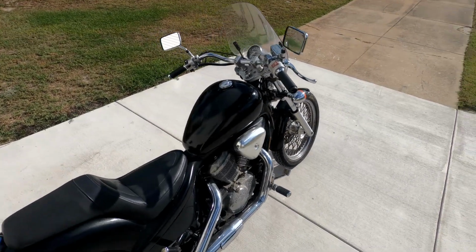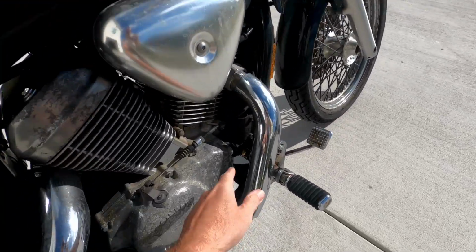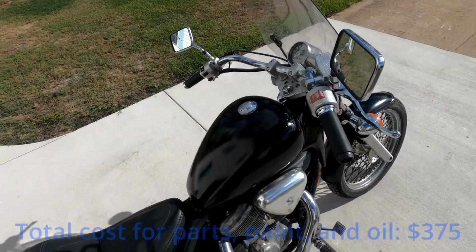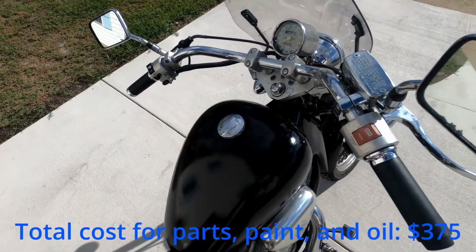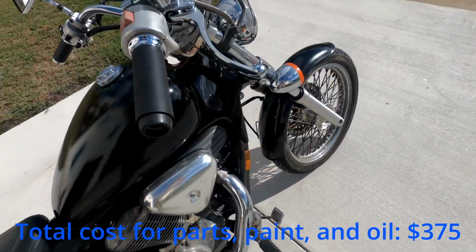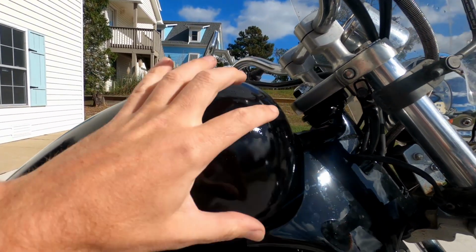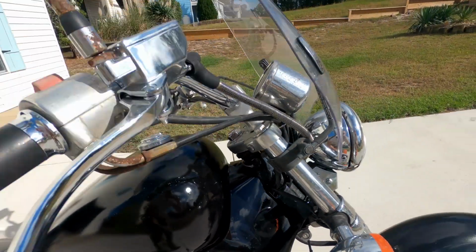We've done a lot to this bike. Rebuilt the carburetor, put a new heat thermostat in there to actually switch on the fan, painted it. This tank has been a headache. So what I ended up doing, again, sanded it down, was doing JB Weld, just a 2-part epoxy on it. But every time I repaired a hole, 10 more popped up. Not sure if you can see these little bubbles, but even in this area right here, there's probably 20. So there's tiny pinholes all in the front of this tank.